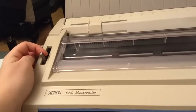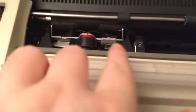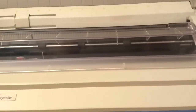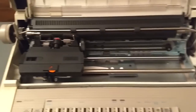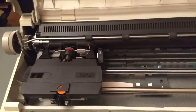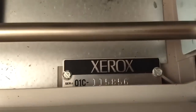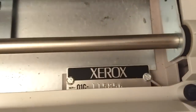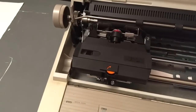You've got this little lever here to release the paper so that you can pull it straight out or when you're putting a piece of paper in. And then this lever retracts the paper bail. This cover here flips up — there you can see the printhead daisy wheel. This big cover lifts up as a whole. From there you can change the ribbons and change the daisy wheel — you can swap it out for one of a different font. And there's this metal plate inside with the serial number and the Xerox logo — it's a nice thick metal plate instead of just a sticker.